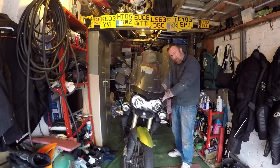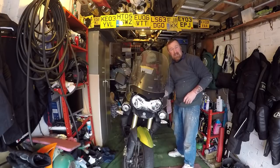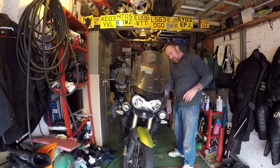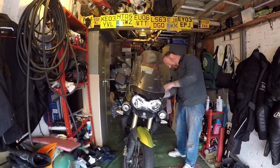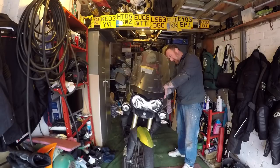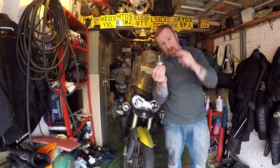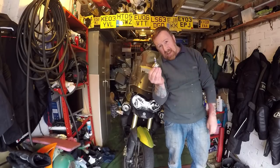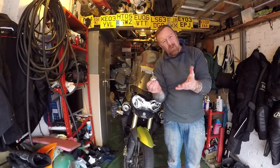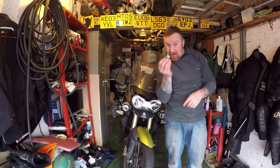The cap can't come off on this one because of the cable, and we have gone to the right side again. So you sort of split the fingers in half, as it were, top and bottom. Out it comes, and you move away with the bulb. Like so. Very careful, do not ever touch the end of this bulb. Your hand has got all sorts of greases on it. This gets so hot it can blow the bulb. So take care of these.